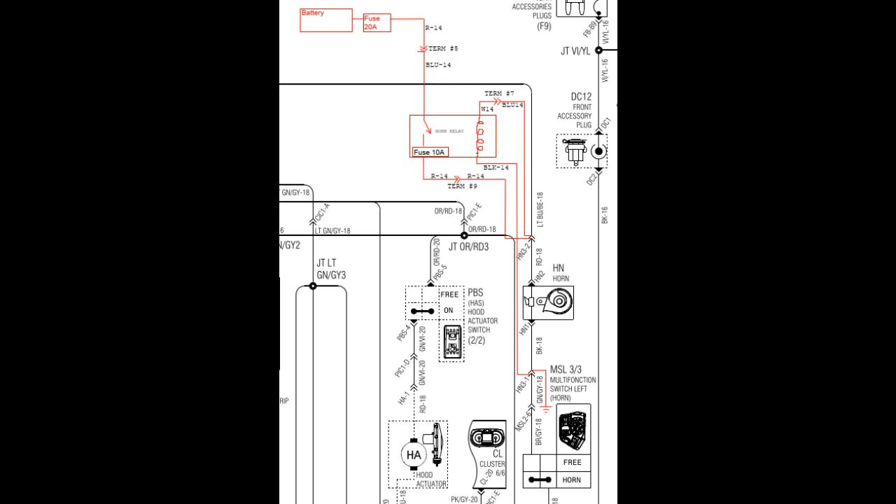That will complete the circuit that will actuate the relay. Next, we're going to supply 12 volts directly from the battery to the horn. Get an inline fuse unit and connect it directly to the positive post on the battery. Remove the fuse so we don't have to mess around with that for right now. Run a 14-gauge wire from the fuse block or fuse module and go directly to the common relay post, which is probably going to be number 30 on the relay.